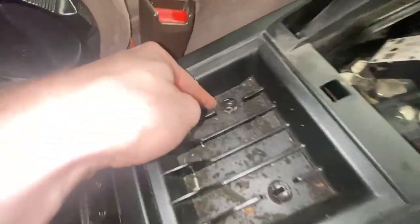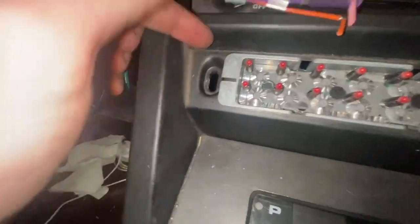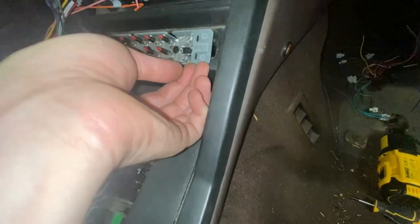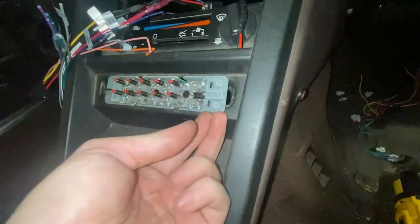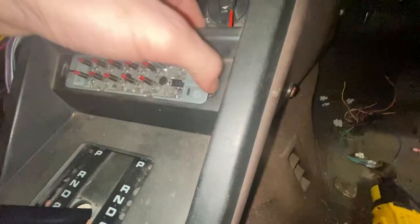There are two screw holes in the little tray that you undo — I've just left those there so I don't lose them. That releases the whole rear end. There are two behind the trip computer; this one you can get to really easily once you've taken the front cover off. The one on the other side is just hiding away in there — you do have to kind of pry the housing of the trip computer out a bit. It looks scarier than it really is; it doesn't seem particularly fragile, and mine hasn't broken any clips or anything.